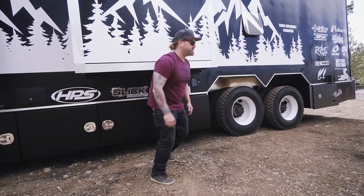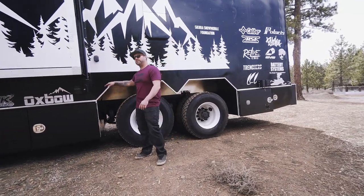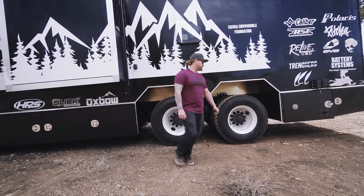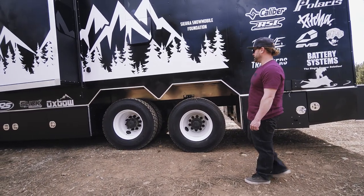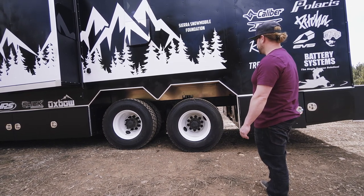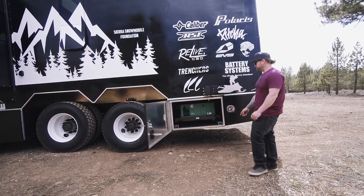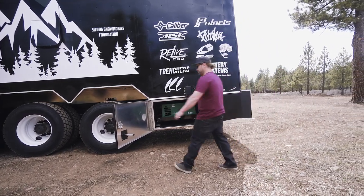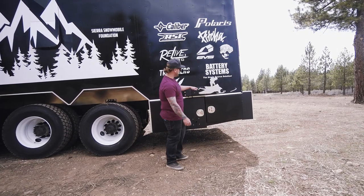All the plumbing runs underneath the floor — there's a subfloor in here, and under it we have our black tank, gray tank, and the freshwater tank fill. Here's the tandem dually bogey we welded into the existing frame — it came with air ride so we're riding plush. We also have an Onan QG4 4000 generator to keep us going while on the road.